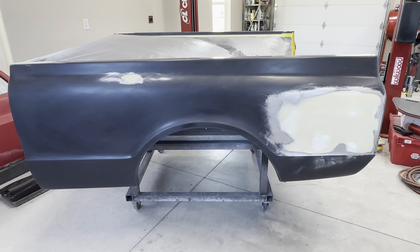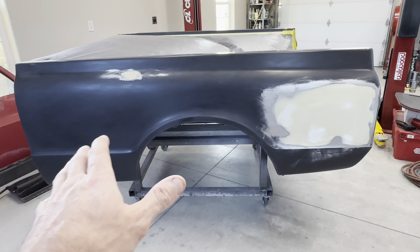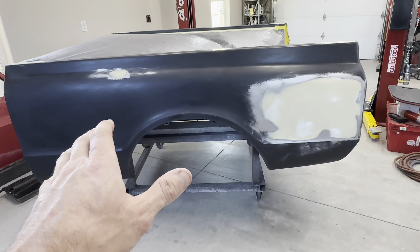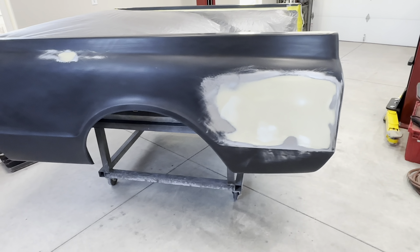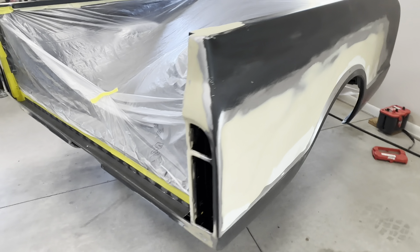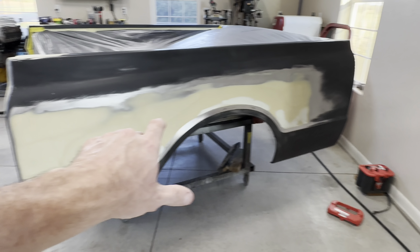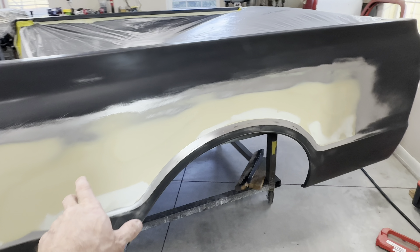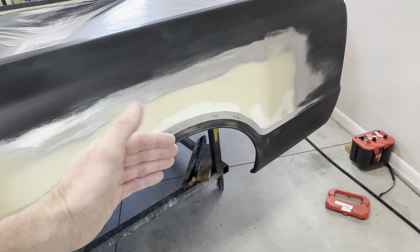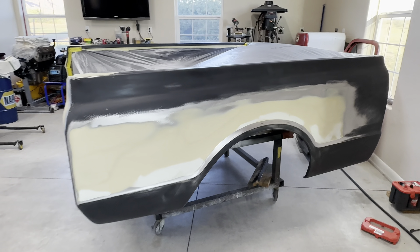Here's what the bed looks like — ready for a first coat of epoxy primer and high build primer after that. All the major metal work has been done and pretty much all the initial heavy bodywork is finished. I'll give you guys a walk around of all the problem areas that I had to hit. This bedside over here is definitely the worst. I had quite a few issues along here with the straightness — specifically a ripple where, when this was stamped, there was a low spot all the way around that ridge.